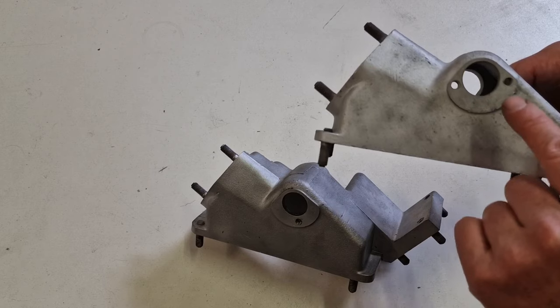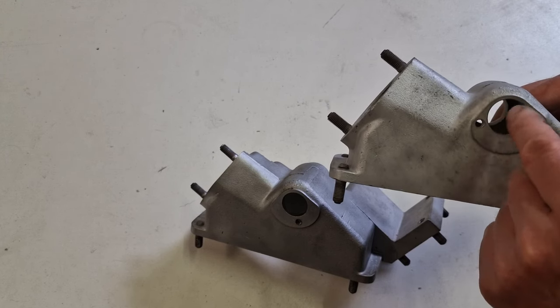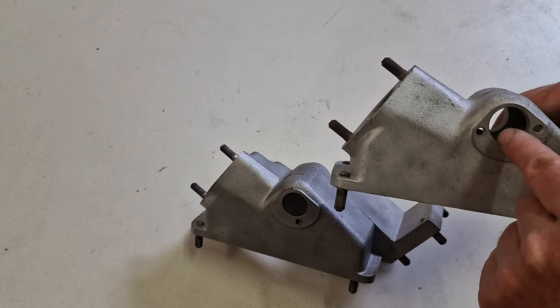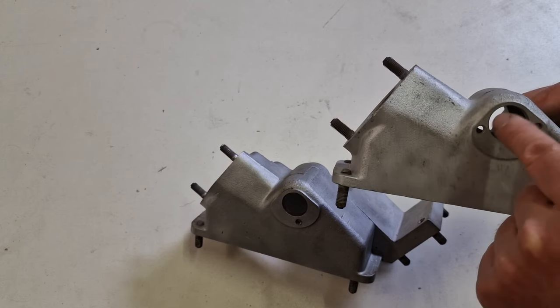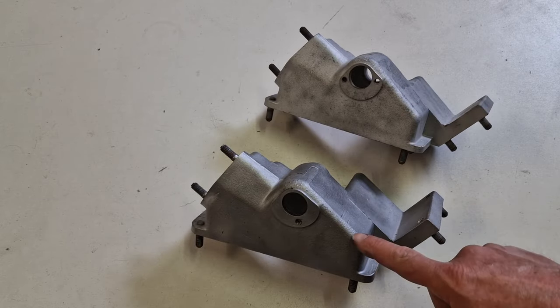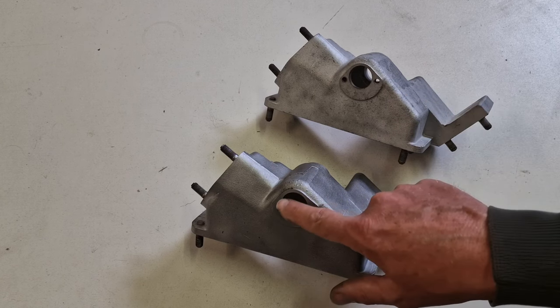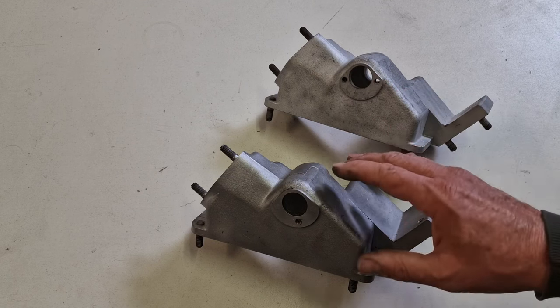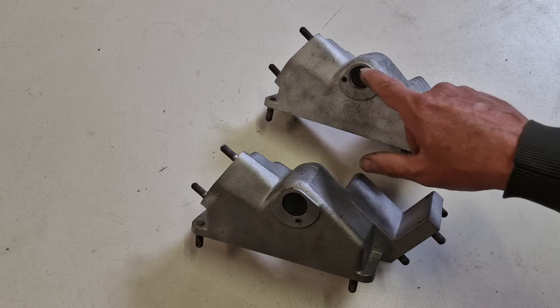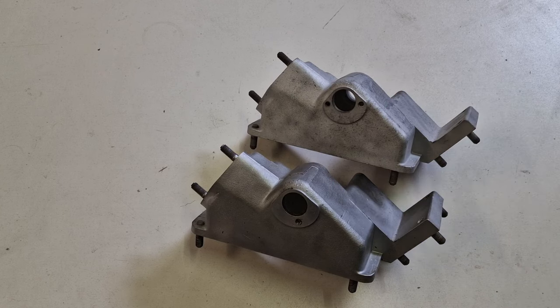See, this one I'll leave like that. That has a hole here, and this one has two holes. And it's not a brass bush anymore. It is a steel flange sitting on here with the brass bush over it. So that is how it's maintained. As you see, this is the very first version. I think this was up to N61, and then they had the improved version. Maybe the cost of the brass was too expensive and they only had a small ring here. Or it might be something else, but you see the diameter here is larger as well. And this went on up to late 64 or beginning 64, late Series 3.8. And then you have something which looks again very similar, which is this one.